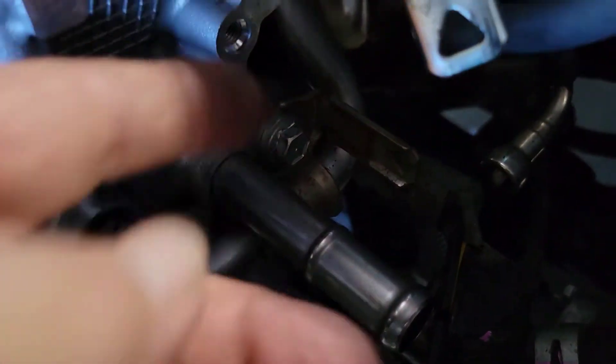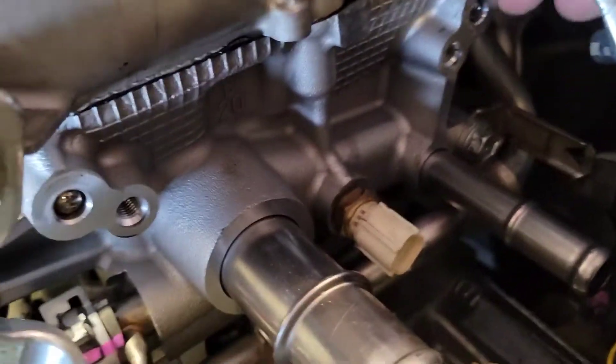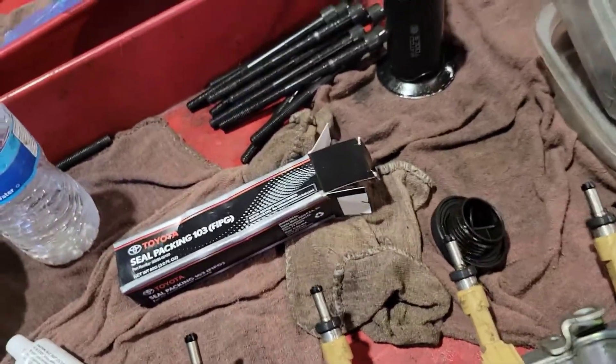Once you've got your heater hoses on, connect your heater hose here and connect the heater hose pipe. There's a bolt there under the radiator hose connection and two bolts at the back to secure that heater pipe. Then we're going to put the fuel rail in — one bolt there and it wraps around and slips right on. Don't forget new seals on your injectors and clean up your injectors. I like to lube the seals with Silglide. Also don't forget the two plastic spacers that go between your fuel rail and your cylinder head — those are really important, don't forget those.